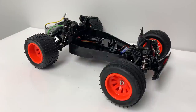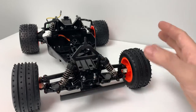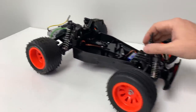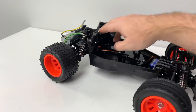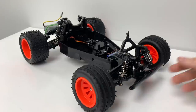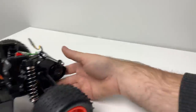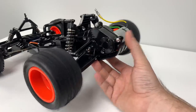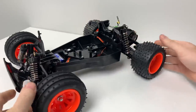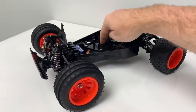That's pretty awesome. I'd forgotten how wide this thing is because of the offset of the wheels — that's the whole design of it. Front suspension feels great — I did think it might be too soft, but it feels awesome. Rear is a lot harder, but obviously we've got the weight of the battery to go in. I've got no shock collars on, that's just as it is. A bit bouncy on the back end, a little bit dead on the front. But if you just press in the middle, that does feel really nice. Also gives me the opportunity to feel the diff — nice and smooth. And then the motor — yeah, that feels nice. It's a really good looking chassis. As soon as you add those wheels and tyres on, it starts getting that crazy look to it.